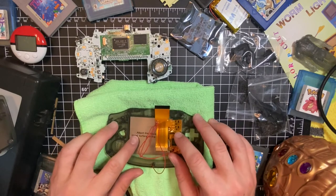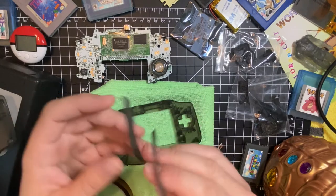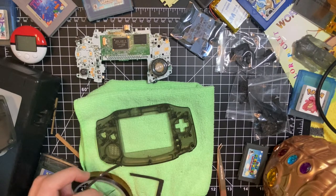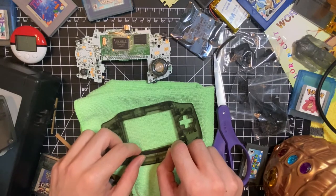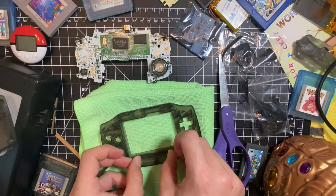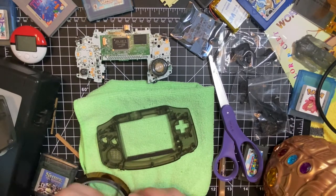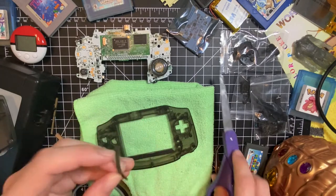I have this little adhesive sticky stuff from the original screen. The new screen is trimmed bigger — it's actually larger than the original. I'm just going to cut some of this adhesive so we can use it to get the screen locked in place without using 3M adhesive. I don't like using 3M because it's too strong, and if you ever need to futz with the screen it can damage the LCD display. This rubber-like sticky stuff feels a little safer in my opinion.